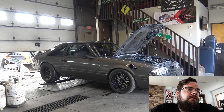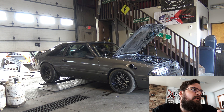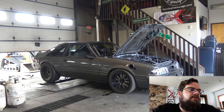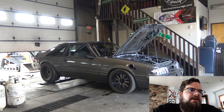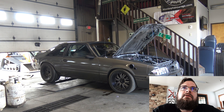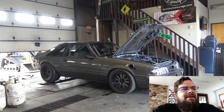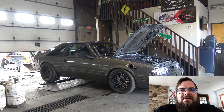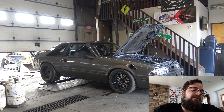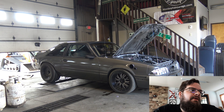Super quick one here. I had this car on previously. It is a 5.3 Turbo LS Mustang on a Terminator on pump ethanol with a TH400 XHD converter. I don't know what injectors or map sensor. It had an S475 cast wheel and he upgraded to a billet S480, and it did pick up a bunch of power down low and up top. It seemed to have better spool characteristics with the billet, hitting full boost sooner and holding it full. Made about 800 ponies.